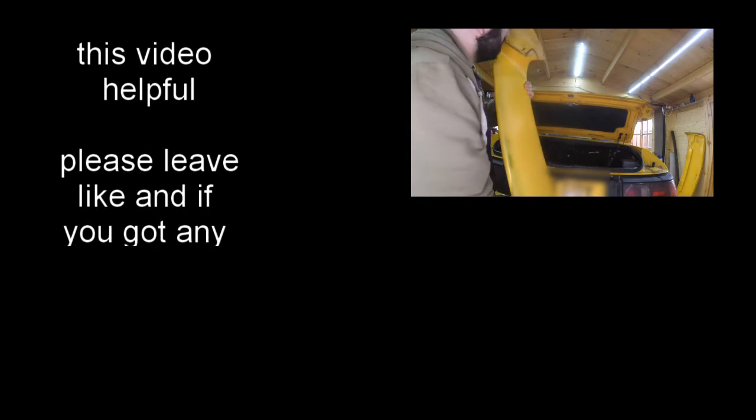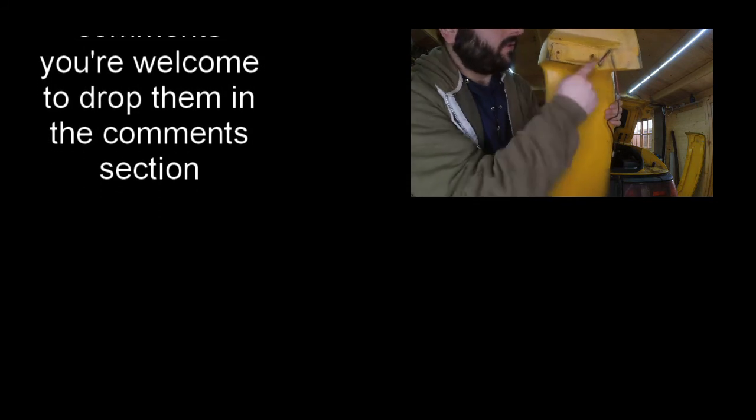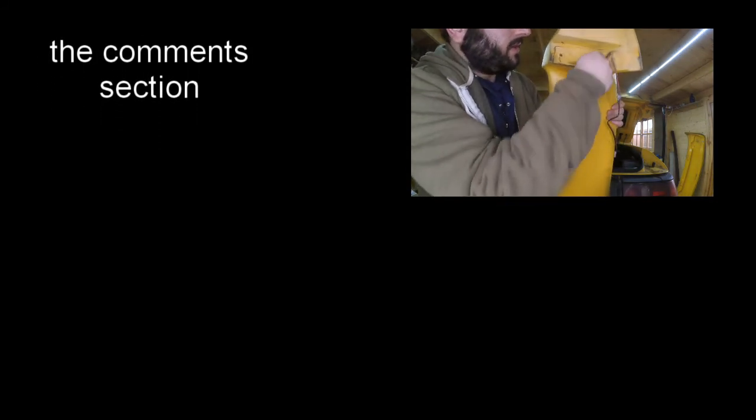And then just lift up the spoiler. So yes, there's nothing special here. A very trivial task, only 4 fasteners, 1 nut, 1 bolt per side, and the spoiler comes off. No problems at all.